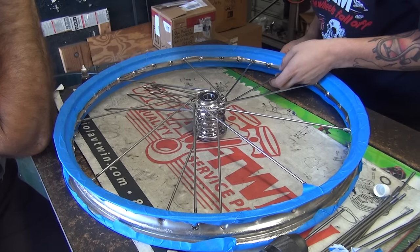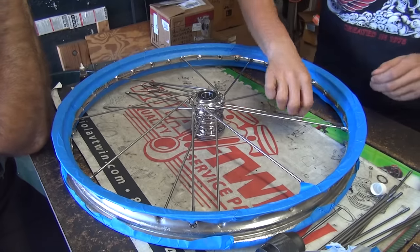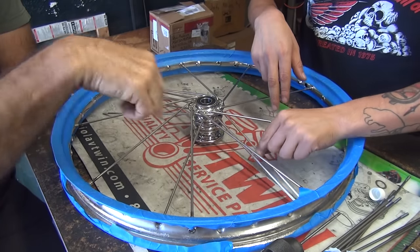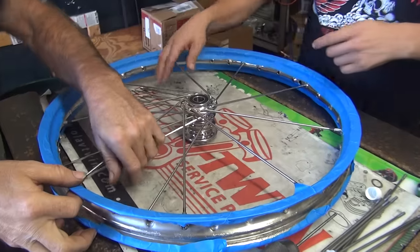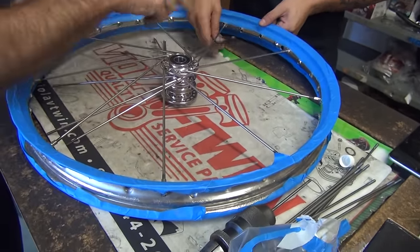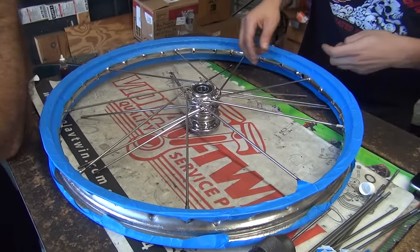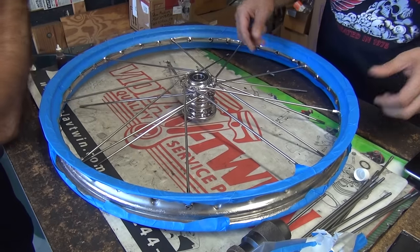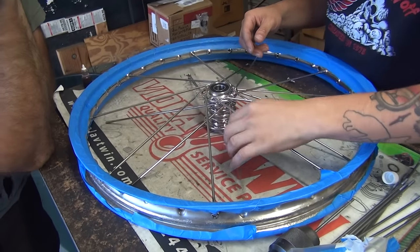How come you're putting all the spokes in the same direction? Oh yeah - this has to go all the way over here. So it gets stronger if they counteract each other? Yeah, that's right. So now you start kicking them in the correct direction on the whole bottom row. If you pick the rim up a little bit so they don't scratch it, you can do that - good job. You don't want to ruin that sweet nickel plating chrome finish polished deluxe sparkle. So you just go like that and knock them all that direction.